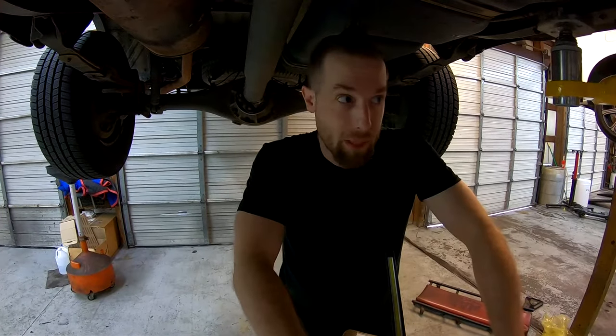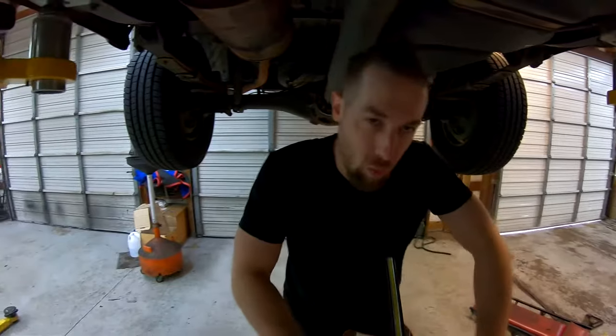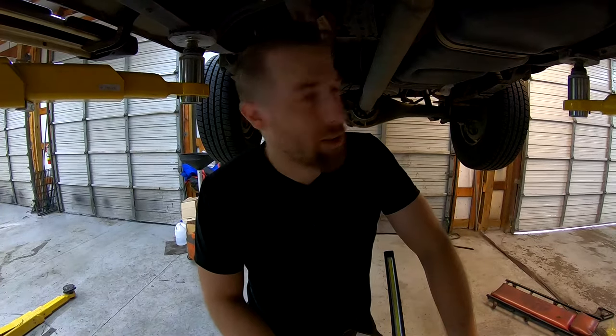I guess I'll make a little documentation on how we did it. So if you have a fuel smell, look for the top of the hose. Why it's chewed up like that, I'm not sure. It has to be some sort of animal, is my assumption. Also, on top of the gas tank, there's a bunch of ants.